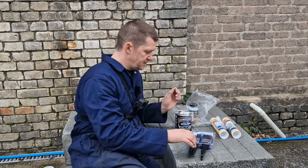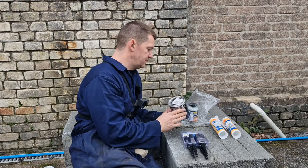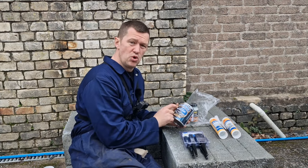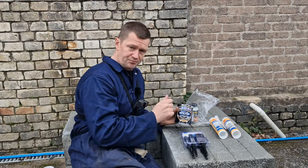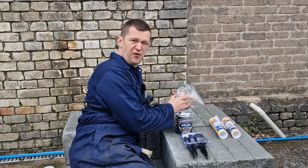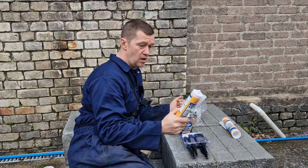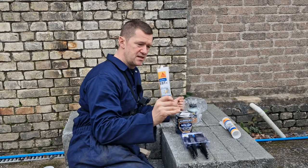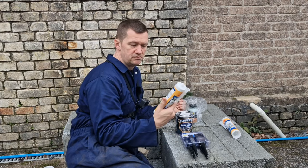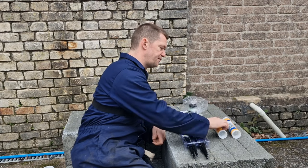So let's see what we actually got from Screwfix. We've got some no-nonsense brushes — a pack. They're almost disposable, this quality. We've got the Hammerite paint; this can actually go directly onto rust, but we're going to put some rust converter on some of the worst places. It will also go onto the metal with only a light brush from the brass. We've also got the rust converter — I think it's phosphoric acid, which obviously is an irritant. And then trusty Sikaflex. This stuff is great because it sticks, it's waterproof and it's flexible — like I use it on the boat and stuff like that, because things are always moving around and not staying exactly square. This stuff is absolutely brilliant for that.